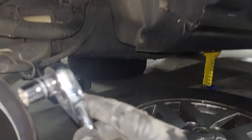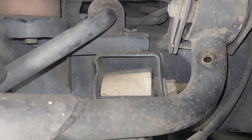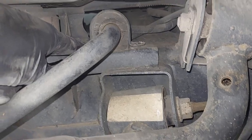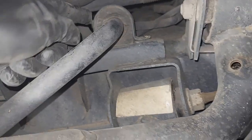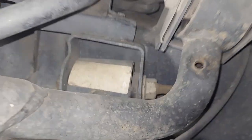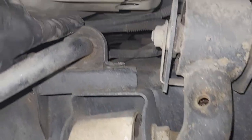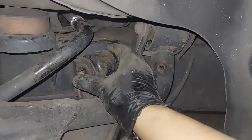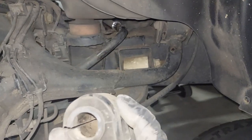The bolt is a 13mm socket. I've taken both bolts off, so I need to lever them out using a screwdriver or crowbar. I'll take the bracket off, then push it out and get the bushing out as well — taking it off on this side because there's not enough room above. It was pretty hard stuck on the bar so I had to pry out the bush itself.